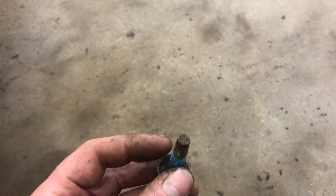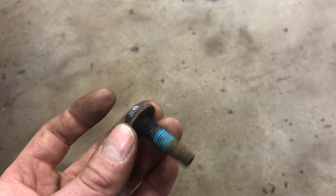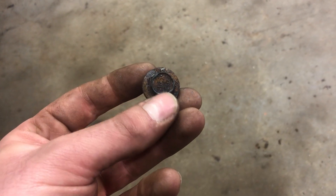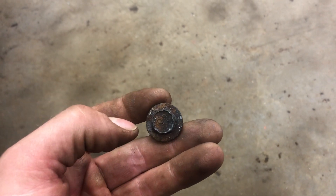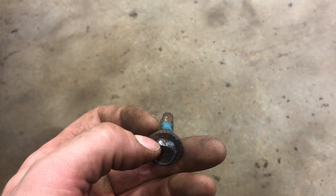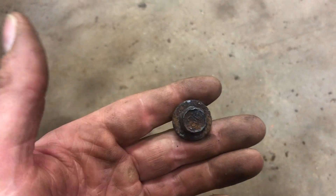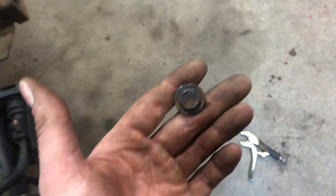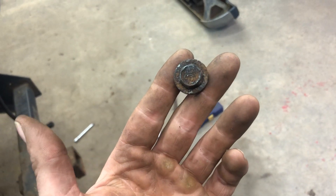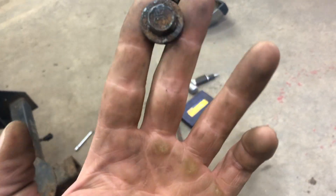The Dodges are different - Dodges have a nutsert through the bottom of the bed, so the bolt goes through the bottom of the frame up into the bed itself. What I did is I got under there with my acetylene torch and I heated the head of this bolt - this baby was cherry, she was hot. Then I got my easy out, which basically just goes over the mangled head of a bolt and has teeth that grip into it. The first couple I used a ratchet and wrench to crack them loose and I couldn't believe how easy they spun once they were hot. After the first two I started using my 3/8 air gun with an extension. These are really easy to get to because the four in the front, two on each side behind the cab, are wide open, and the ones going down the frame have a hole through the frame so you go straight up.